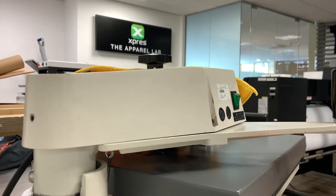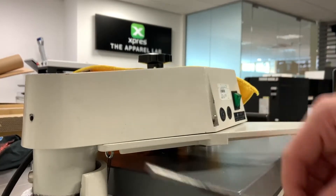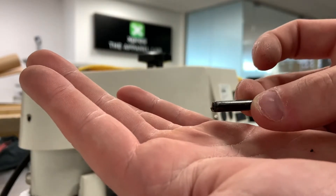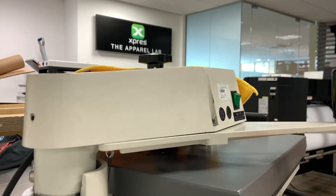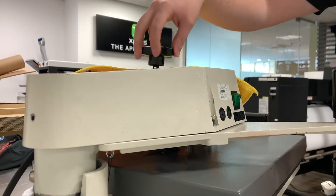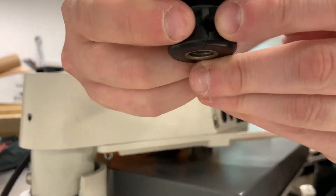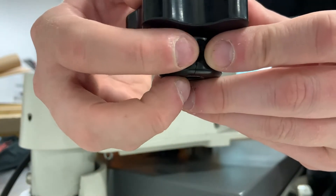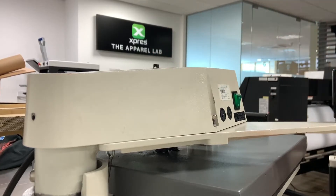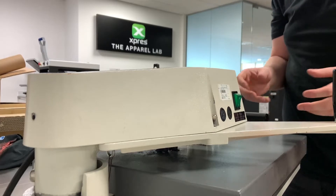I got it right the first time. However, you might notice that the split pin won't budge — if this pin isn't moving when you're hitting it with the punch and the hammer, that normally means you're going the wrong way. The split pin is bigger on one end than it is on the other — it's almost impossible to see but it is — which means that if you're going the wrong way you can actually break the handle quite easily, because it's just a plastic handle, so you need to be very careful. This is the handle; this is where the pin goes through — you see that little hole there. You want to make sure you hit it from the right side. You can see where over time — this is our demo unit — it's started to wear away, which is quite normal. The idea is: make sure you hit it from the correct way, try from one side, and if it doesn't budge with a nice light tap then try from the other side. Eventually you'll hit a point where it's nice and easy to remove.